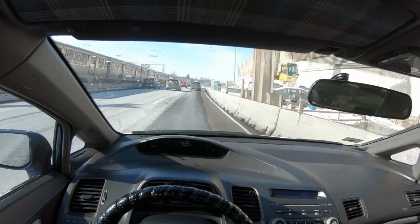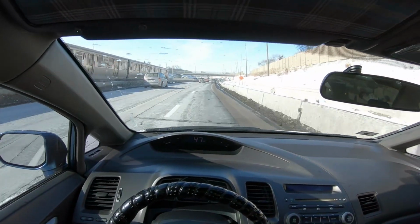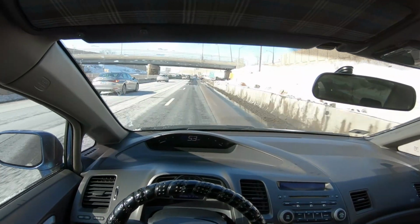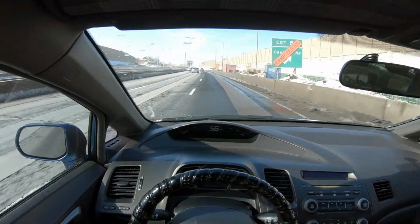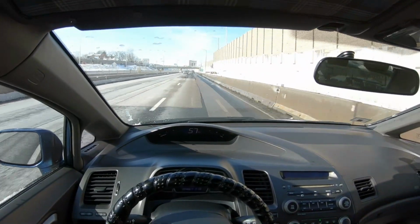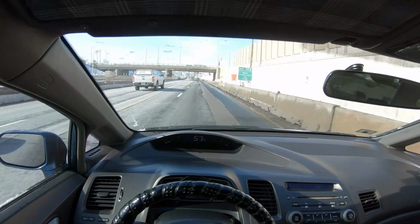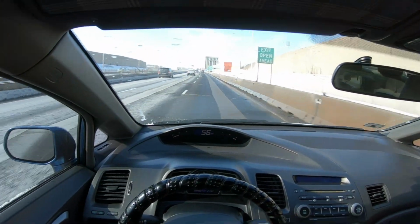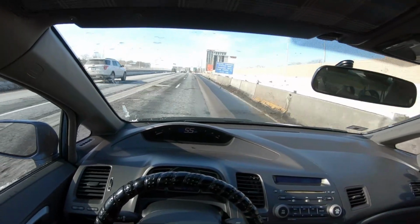I also do want to change my factory oxygen sensor. I got a replacement oxygen sensor here for this car, guys. And I want to change it and just watch the fuel trims. I want to see if that $30 eBay sensor is going to be decent for this car, because I got 95,000 miles on this car and the factory sensor is probably on its way out, and I would like to have a more accurate reading sensor. Now, will the eBay one be an accurate reading sensor for $30 compared to something that costs $120 brand new? We'll see, we'll find out. If it is, we'll run it for the turbo build. If not, we're going to probably run the stock one and eventually upgrade to a Denso OEM sensor, if that makes sense. Anyway, guys, enjoy the video. We're gonna go our way to Andre's house right now.